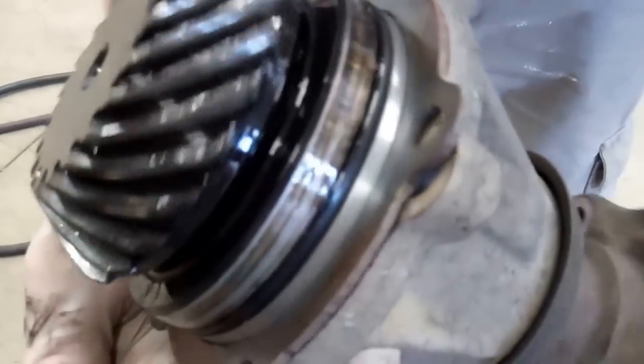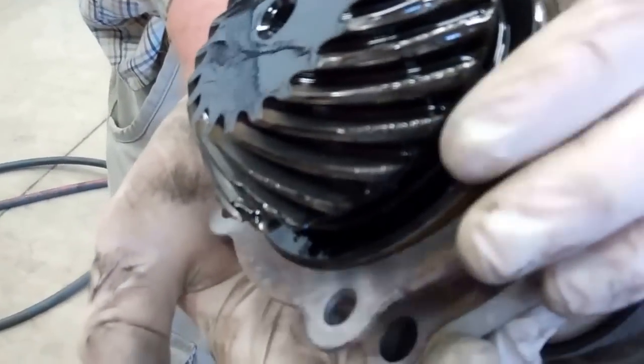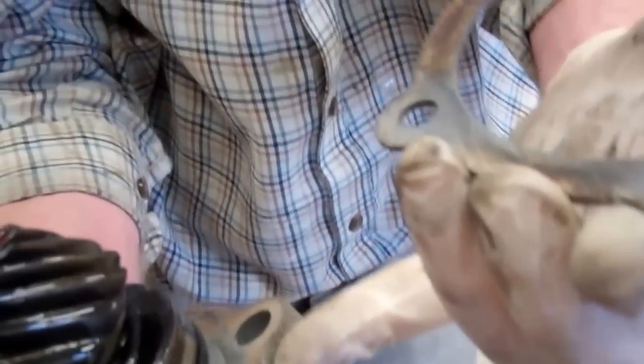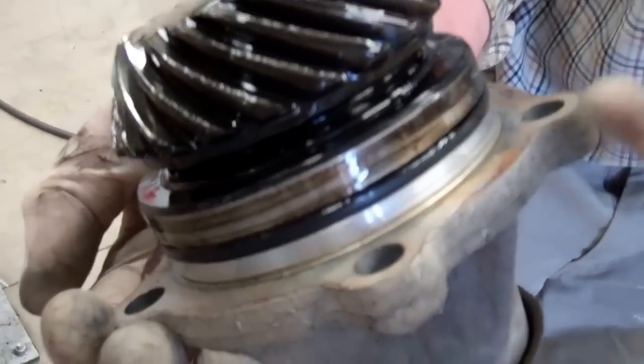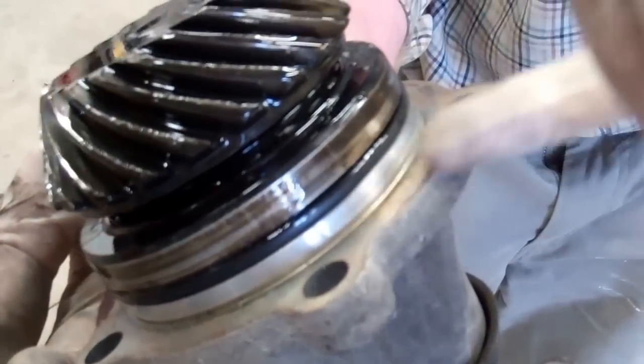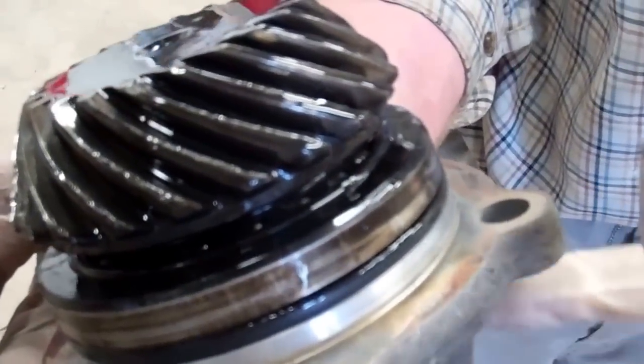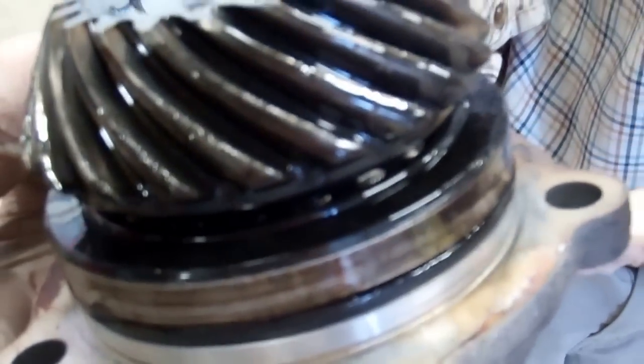So this is the unit in question. Okay, so basically we're going to throw this in the bin and we're going to take these gaskets off here, and we're going to now reuse this. Now you'll notice there is actually no gasket on here. These are accurately machined surfaces. There's no silicone, but we'll put a little bit of silicone on and we'll get our blanking plate and we'll put it all back together.